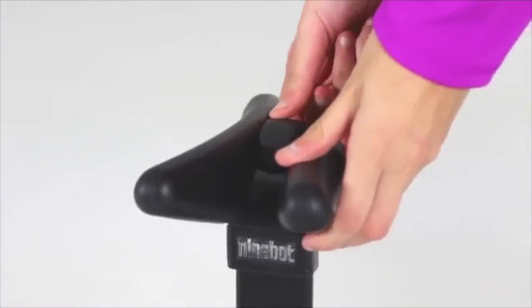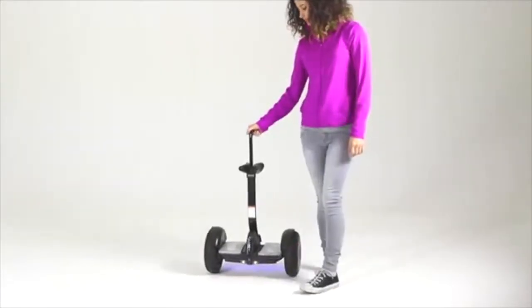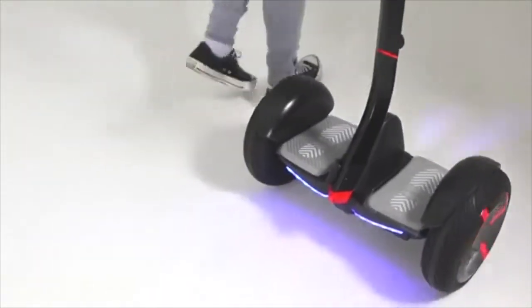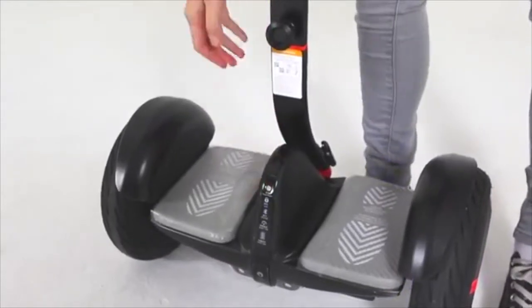Lift the guide bar to help steer the miniPRO without a rider when powered on, but do not use it to lift or carry the miniPRO. When not riding your miniPRO, you may extend the guide bar to pull the miniPRO with it powered on. However, do not push the miniPRO with the guide bar, as it will retract. Once assembly is complete, check the power on-off status.